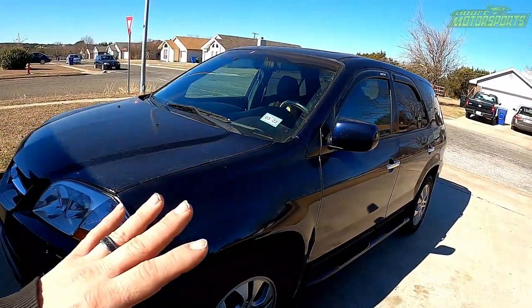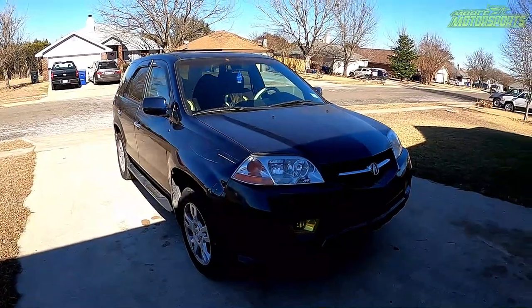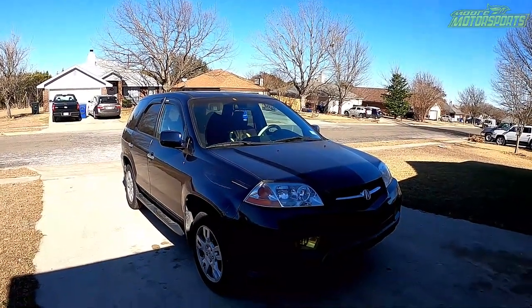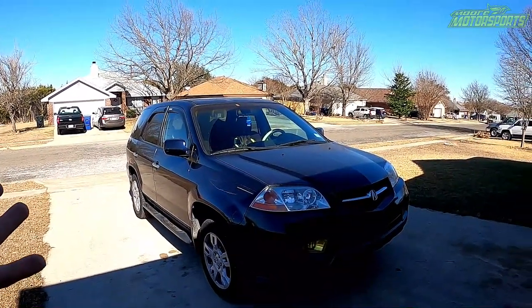So after I get this entire thing sanded, we're going to try to get it in a paint booth so I can lay down the white. Basically, I'm going to lay down a white base coat with Rust-Oleum Advanced Formula spray paint, and then over that, we're going to go over it with the white bed liner. I'll show you how to mix all that stuff up. We're going to add the pigment powder, and we're going to hope this baby glows.